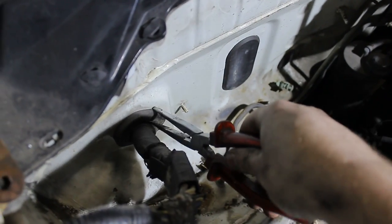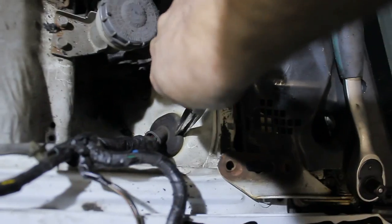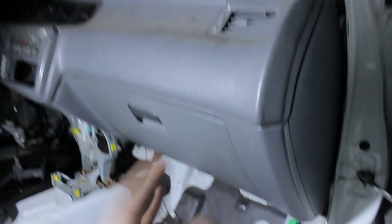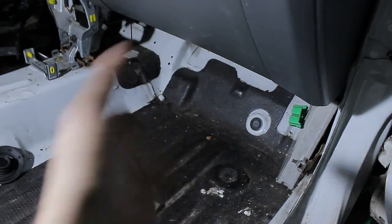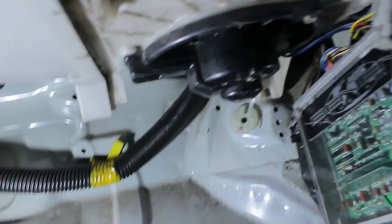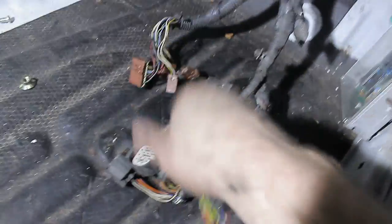Time to put everything back into the cabin. My advice is to first push the rubber in with needle-nose pliers — push it in from the outside, because it's easier than from the inside. At this point I'm very happy that this car doesn't have an interior except for a dashboard. If you have an interior, you'd need to pull the carpet back and there's a rubber mat behind the firewall you'd have to pull back too, and then you can reach the wires behind. The wires are in an absolute terrible location, all the way up there — Honda didn't really intend for you to wire tuck their cars.